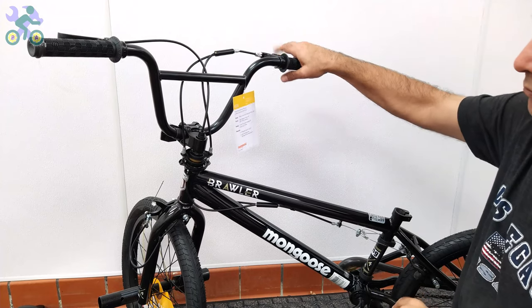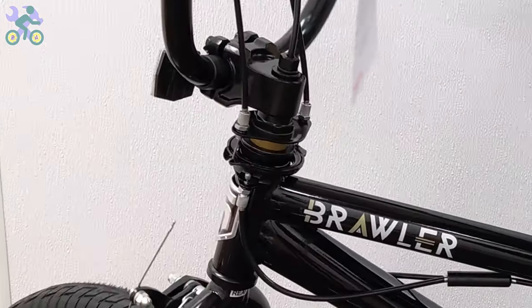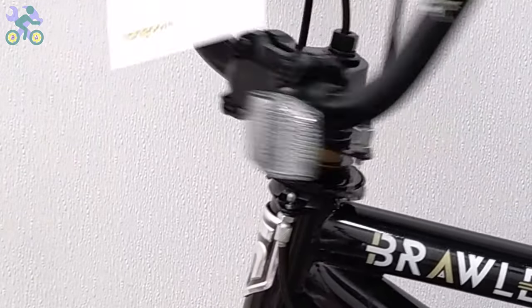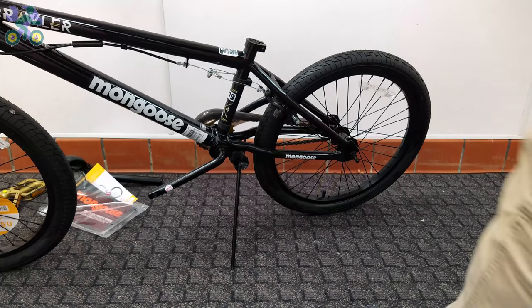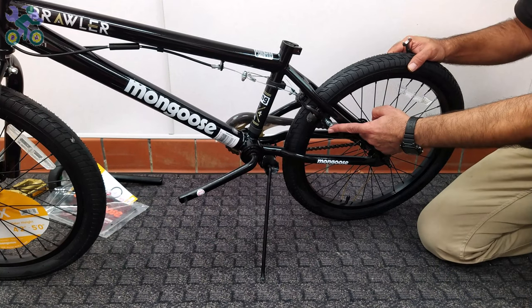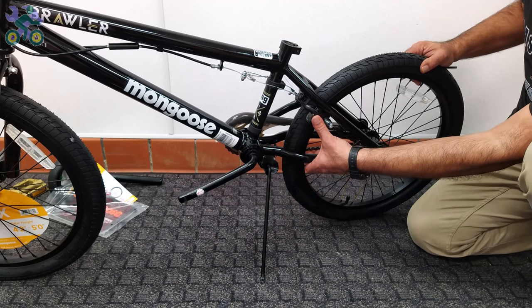Move the handlebar left and right. If you hear a clicking sound, it indicates that the upper brake plate is not properly aligned. To eliminate the clicking sound, increase or decrease the length of one of the adjustment barrels on the top plate to achieve the desired alignment.